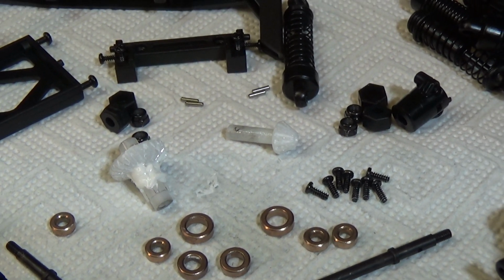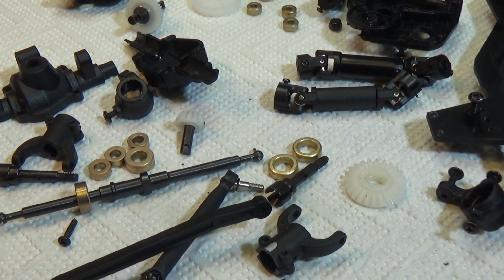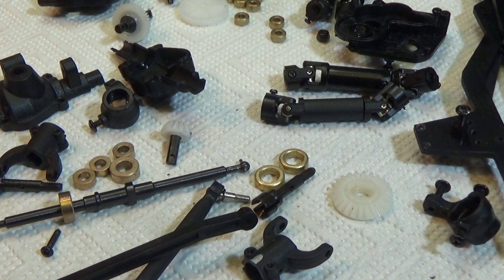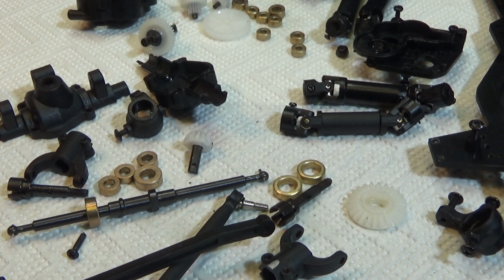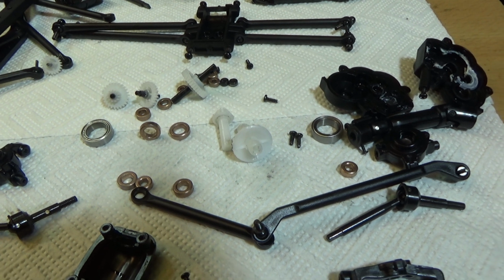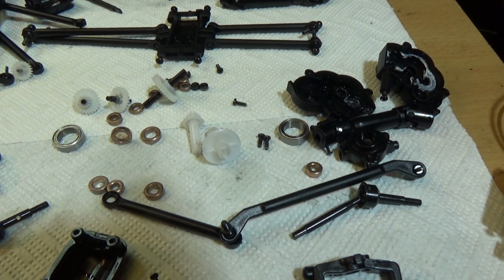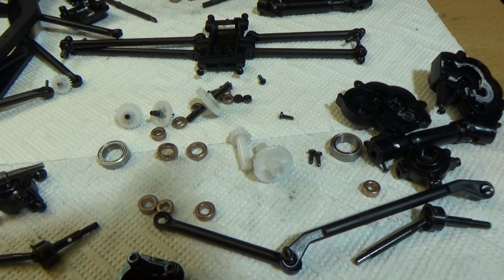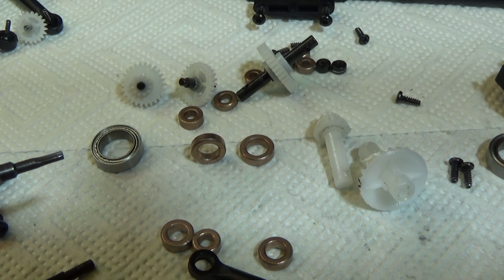And in the front axle it's the same. The RocHobby Katana and the CR-18 do use 3 pieces 6x3 by 2.5mm bearings and 2 pieces 8x4 by 3mm bearings and 2 pieces 8x5 by 2.5mm bearings, while the EazyRC models do have 2 pieces 6x3 by 2.5mm, 2 pieces 7x4 by 2.5mm bushings, and 2 pieces 8x5 by 2.5mm, and they do already come with 2 ball bearings, those large ones with 12 by 8 by 3.5mm.